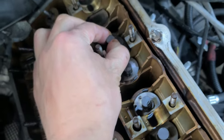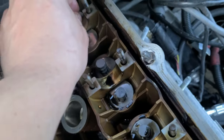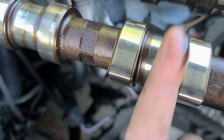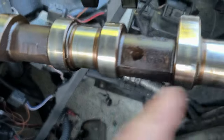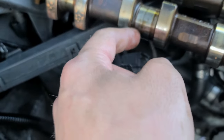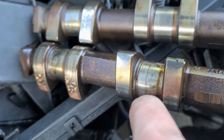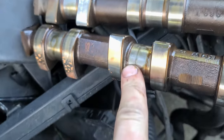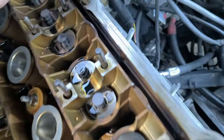Hopefully they will hold it up when I lift it, because apparently, as I say, you cannot mix stuff up here. Everything has to go where it always sat. And why? Because, for example, you see, there are microscopic scratches here and there. Not on this side. Let me see if there's the worst one. They're all pretty good, actually. Very, very good. So this one is the worst one. So anything that scratches this and has been scratching it is an example of why this one should go exactly where it was before. Otherwise, I'm gonna have extra wear that I don't want.